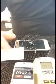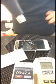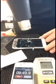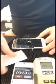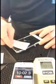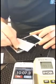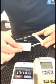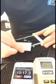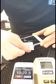With these larger bits of glass, I'm actually going to use a business card just to reduce the amount of leverage I'm putting on the glass. Again, we don't want to pry up. We're just looking to get between. Prying up, you're more likely to break it. So, business card is flexible enough, you're not going to damage anything. But at the angles we're using, it's still strong enough to do what we need.